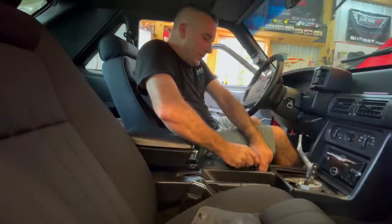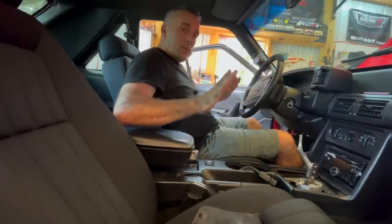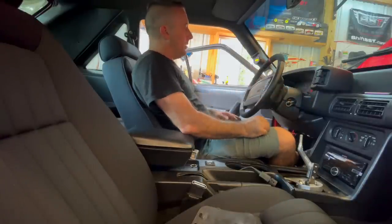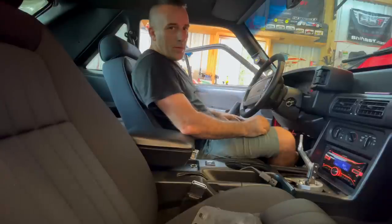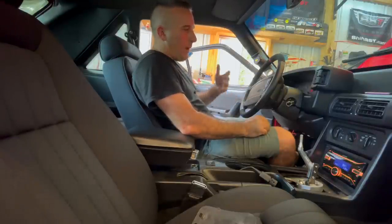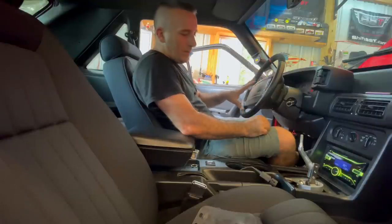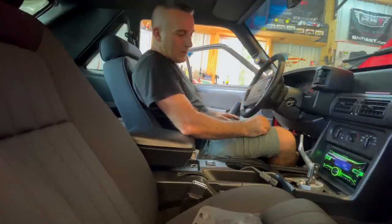The way we want to do this is: unhook it, we're ready to do our new sensor install, and we turn this on and we literally just wait 30 seconds or more. That will allow this thing to calibrate. It's that simple. So I'm going to go ahead and do that, then I'll hook the sensor back up and show you guys what I'm talking about.